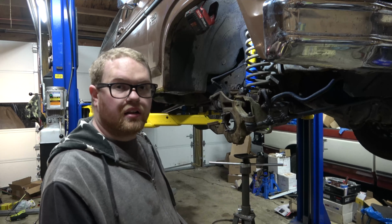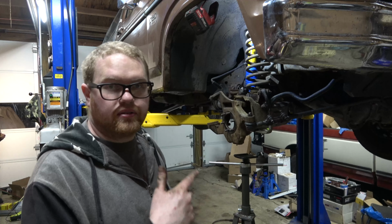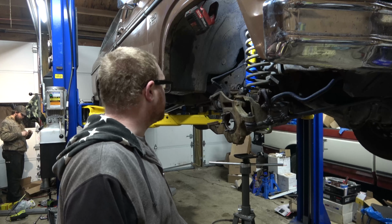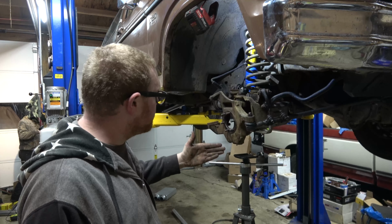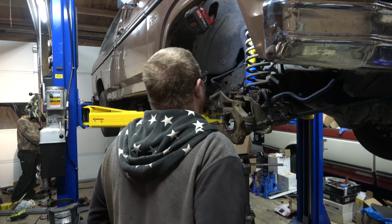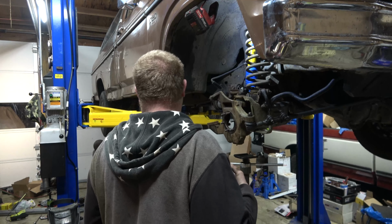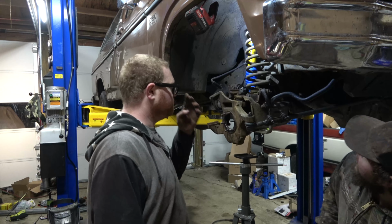degree of adjustment, whatever you want to call it, kick this out. Then when I get home, before I take this in for alignment, I'll swap in my new deal. After swapping that around, the toe is probably going to be pulled in. We can do a redneck alignment here too if you want. It puts it an eighth inch toe in, and centers the steering wheel just by doing it. All right, cool.